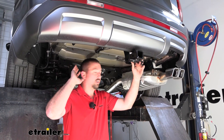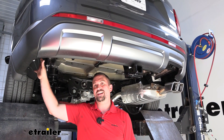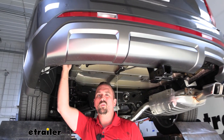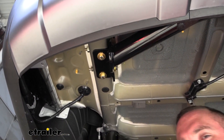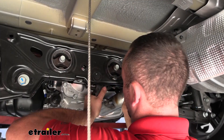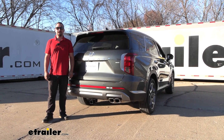We've officially installed our hitch with everything torqued down properly. Now we need to get the exhaust put back up, the spare tire reinstalled, and the plastic panel back on the driver's side. Keep in mind on that plastic panel, the threads of the bolt can get in the way a little bit — if needed, trim that plastic slightly at the top to get it back up. And that was a look and installation of the Curt Trailer Hitch Receiver on a 2024 Hyundai Palisade.